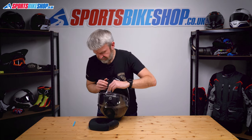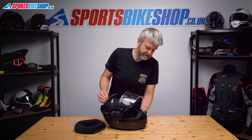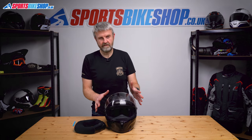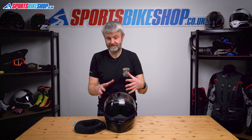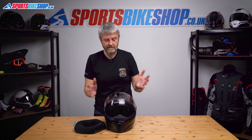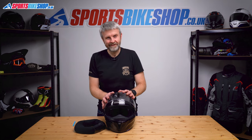Click that in place, just operate the visor a couple of times to make sure everything's functioning as it should. That's all connected properly. Same on the main visor. So that's how you do both of those jobs. That is a bit fiddly. I would say if you really need to do the Shark sun visor then that's how to do it, but if you can avoid it then I absolutely would. Certainly wouldn't take it out just to clean it, because you'll end up with fingerprints all over the visor anyway and you'll need to clean it in situ. So only do that if you really need to, but if you do, that's how you do it. Thanks for watching.